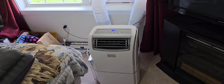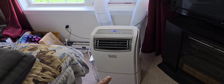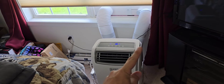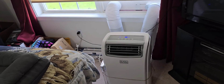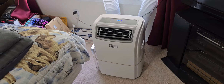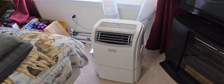If we wanted a true dehumidifier — where we reroute that cold, dry air from the evaporator internally over the condenser coils and send warm dry air back into the room — they're just not built that way. It's going to send it right out the window, and it doesn't matter if you have a single or dual hose; it's just not going to do what a traditional dehumidifier does. Not the worst thing in the world — it still gets the job done — but it's not a true dehumidifier in the traditional sense. You're just going to get your room a little cooler, which in the heat of summer isn't the worst thing, but there is a difference.